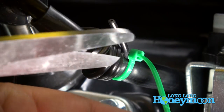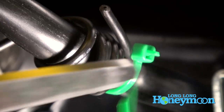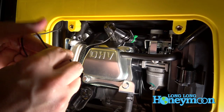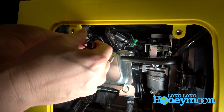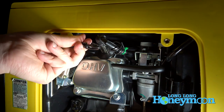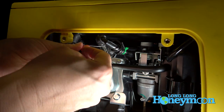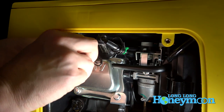Pulling it taut. This excess cable — I don't want it touching any hot parts of the engine. I have plenty of extra, so I'm going to tie it together and kind of tuck it up higher in the case. You really want to leave enough play in the wire so that you can change your spark plug at some point down the road.